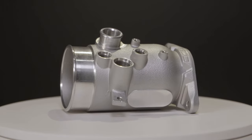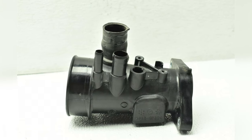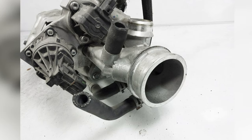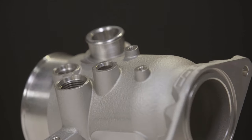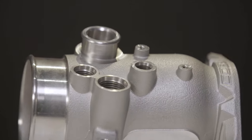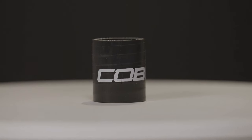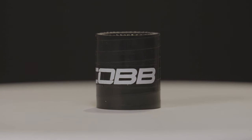The entire unit is cast aluminum, which is one of the most important reasons to upgrade, as the OEM piece is all plastic and is very prone to flexing and cracking under stress. Even Subaru stopped using plastic on the new generation because of the consistent problems. All of the inlet and outlet surfaces have been machined for perfect fitment, including the threaded EVAP and PCV connections. Plus, the bypass valve coupler is a silicone component that's more durable and flexible than the OEM plastic that fails frequently.